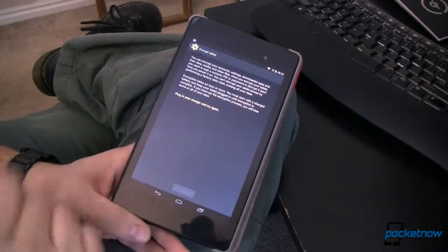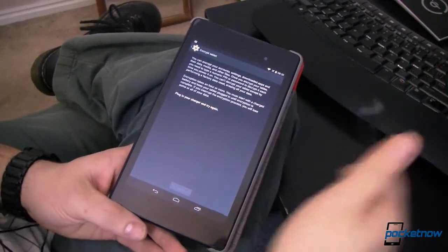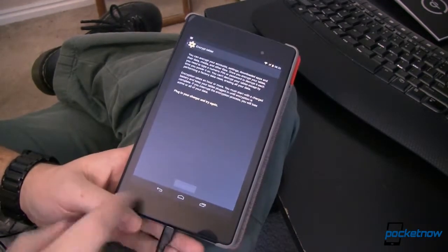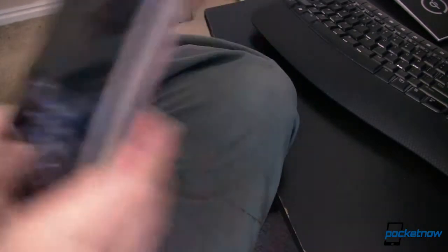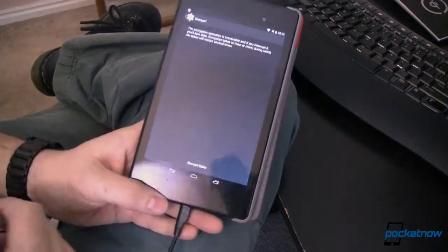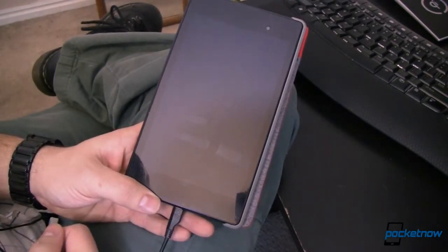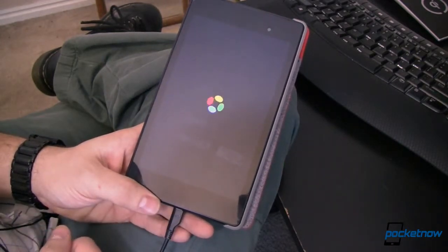I'm pretty close on charge but we also have to be plugged in. I'll get my USB cord which I have plugged into a power outlet and go ahead and plug that in. This should then light up and allow me to encrypt the tablet. It asks me for my PIN. Once that is done we get another warning and then we'll go ahead and encrypt tablet. We get that nice little Android with a tool belt and then the screen goes blank — it's doing its first of several reboots.